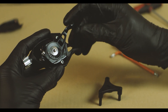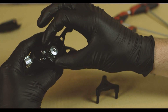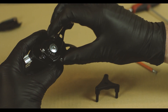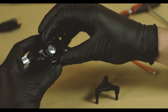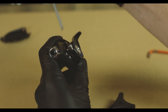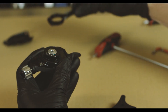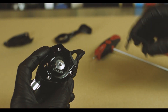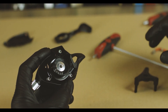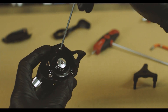On the X01 shifters you can actually remove the lever, and you're going to have to, because this bolt interferes with the claw and that becomes a problem later. So we're going to go ahead and remove this lever now. You can see that the claw matches up with the bolts free of any obstruction, and we can take our 2.5 millimeter Allen wrench and pull these bolts.